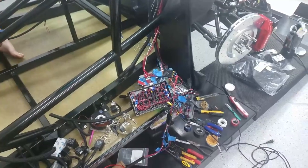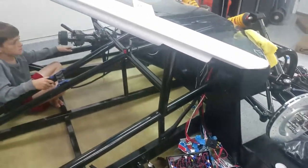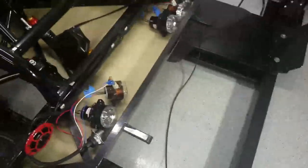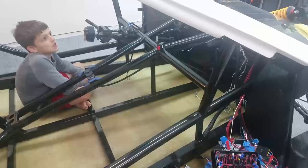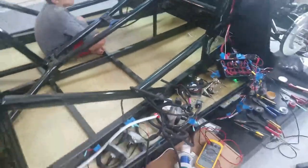It looks like they're all good. Now we're going from easy circuits to harder ones. This one is going to be the park lights. Turn that on and we'll see if the front ones go on, and we also have the back ones — the hope is those glow a dull red, not like brake lights, and the front two have amber lights for park lights. Jack, go ahead... I don't see anything. We'll try again. The first time I didn't have the switch wired — I had all the outputs wired but not the switch. Hopefully this time it works.